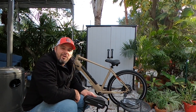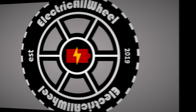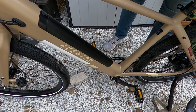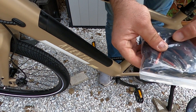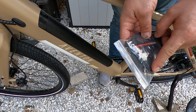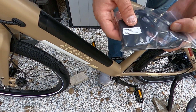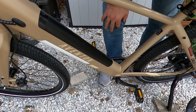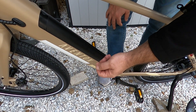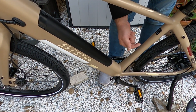If you haven't already, give us a like and subscribe. Here we go. We have our kit — it has the XT60 to bullet connectors, male and female. We also have our braided extension cables, and this kit has the 40-amp discharge balancer. We anticipate the controller being here, so we're going to pull the battery, pull the controller faceplate for the housing, and then see about getting it wired in.